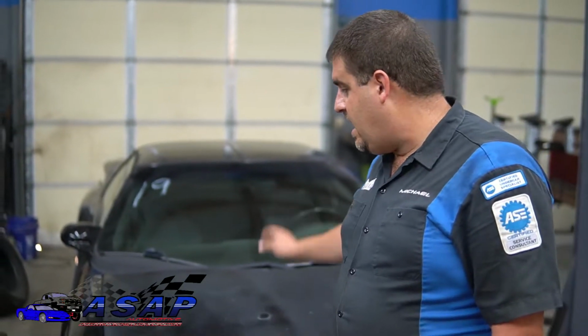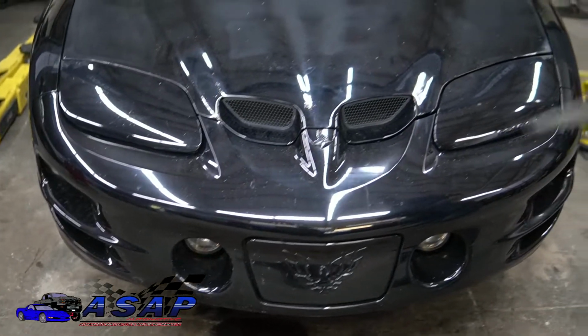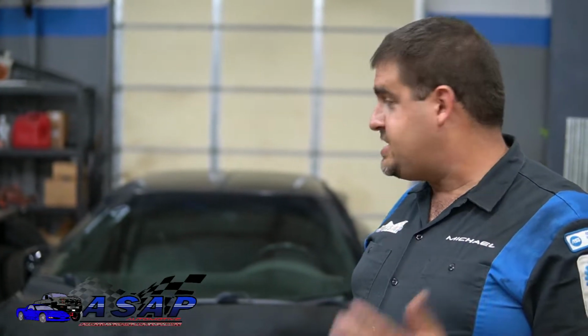And you guys who have been watching the channel know that this is my wife's Firehawk, one I got her a little bit over a year ago. Originally, as you saw in an earlier video, we did some fuel system upgrades to it. We did the 255 Racetronics pump and the hot wire kit. That pump did great, but the problem is I got bit by the ever so common fuel pressure regulator issue in the sending unit in these, and it actually did it to us in the middle of Carolina drag cruise, just about a couple of months ago.